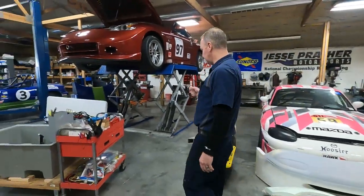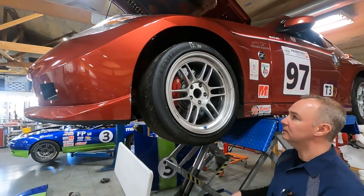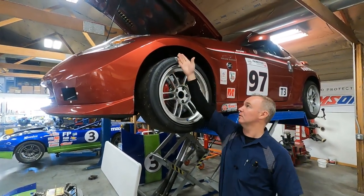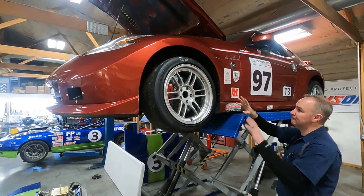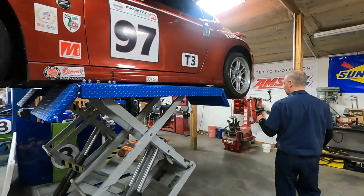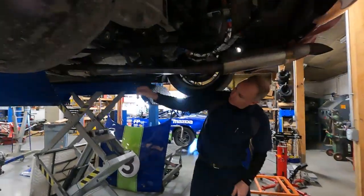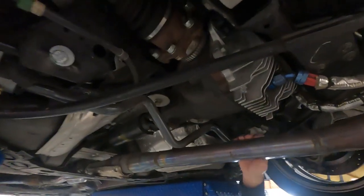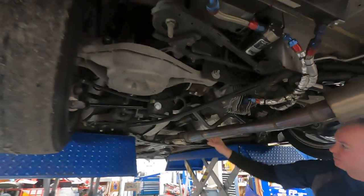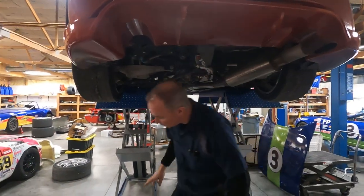Bob Shader's 370 is up on the lift. I'm working on wheel offset because since this car has been run, we're now allowed a 10-inch wide front wheel instead of a 9-inch wide. Getting a 10-inch wide wheel to clear the caliper and fit up under the fender is a tight fit, so I want to make sure we get the right wheels and get the offset just right. I have enjoyed having this car back in the shop because it's got a lot of the cool things we did to it back in 2017 when it was built — like this oval mandrel-bent oval tubing. It's still three inches in diameter but it flattens out here, which gives you a little more ground clearance. It's still got the diff cooler and all the good stuff on it.